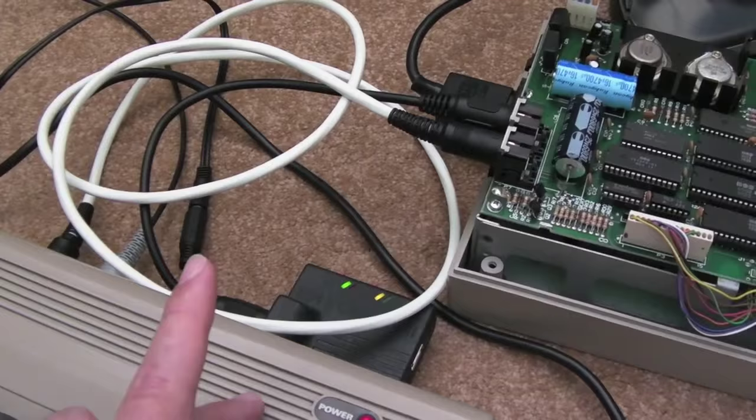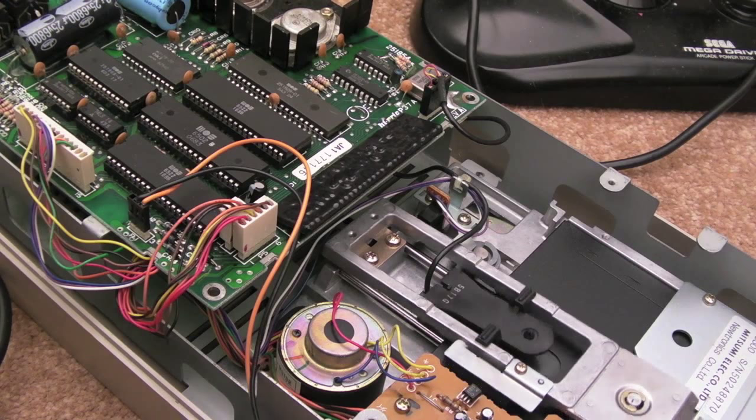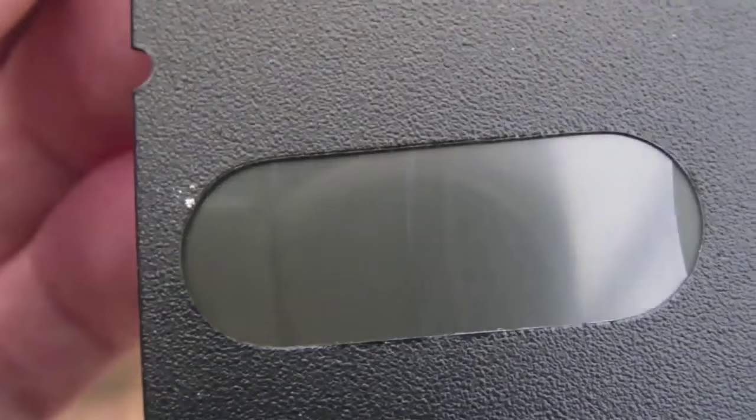Select device 9 as source and device 8 as destination, see if I can program a game to it. After a while it wasn't formatting the disc again — and I think it's the disc. Take the disc out and if you look, starting down here at track zero you can see it's like a groove almost carved into it. I think that's from the particles I mentioned that I couldn't get off with cotton buds — very very small particles. But look at the other side — nice and smooth, how it should look. You've got ridges carved into that first side.